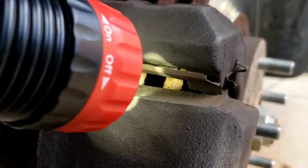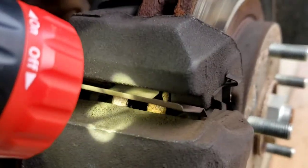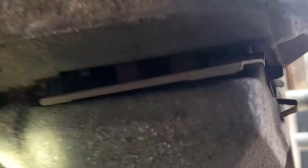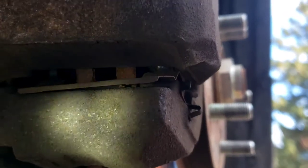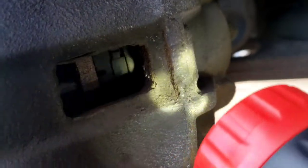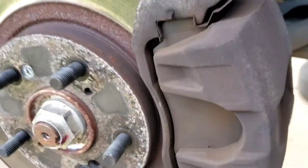Let's look at the one on top inside — it's just like the other one, in good shape. The brake pads are in good shape. This is the left front, let's go over to the right front. You can see the lip — look how pronounced that is, so the brake rotors are thin. Same thing here — brake pads are good, they're practically new. You can see the metal pad, that's the pad, that's the rotor — so you know that's good.